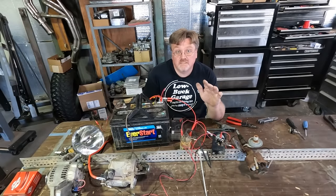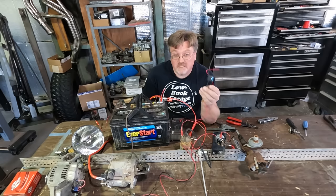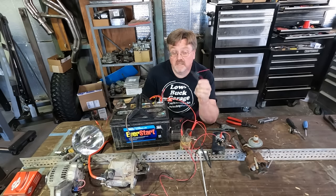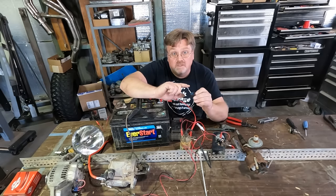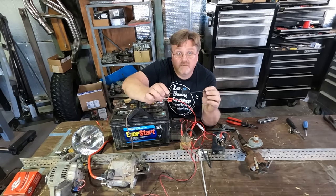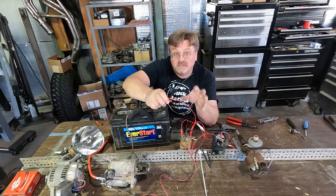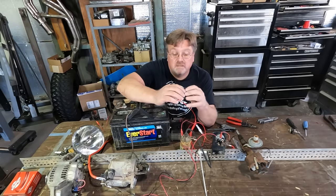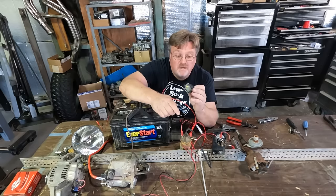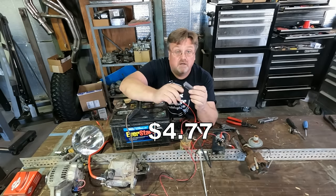Now we need to talk about a completely unnecessary subject — fuses. I say they're unnecessary because you don't actually need these for anything; if everything goes well in your wiring, you will never need them. But it's probably a good idea to put them in. They have a little strip of metal that when the amperage gets too high heats up, burns out, and disconnects your circuit. There are inline ones that are simple and easy. If you start doing a lot of circuits, fuse boxes are cleaner — most cars come with them standard, and a simple little box is only a few dollars.